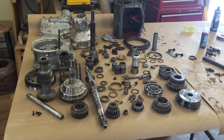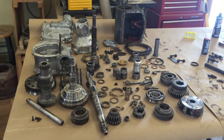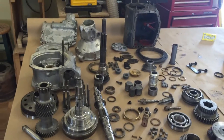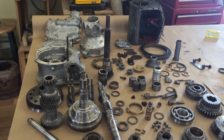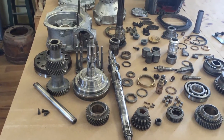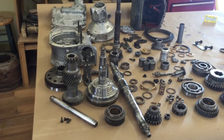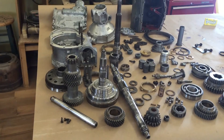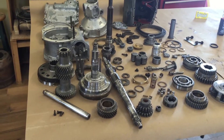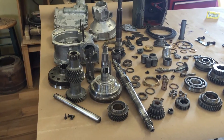After a huge amount of work, probably about the last three weekends, those are all the bits and pieces and parts from a Healy overdrive and gearbox. I will confess that I was pretty horrified when I first opened up the gearbox. It had been drained of oil approximately 40 years ago and basically I saw rust — and there was certainly some rust in there — but most of it cleaned up really nicely. A wire wheel did great things.